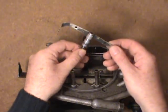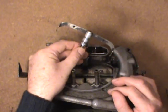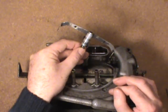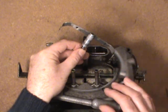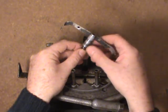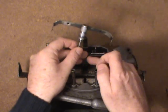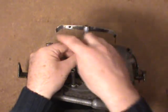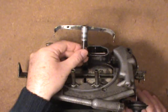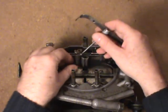If you didn't have that step-up cam like they have in the Thermo Quads, vacuum would hold that down. If you're doing a full throttle acceleration, vacuum would drop, the spring would have more power than the vacuum signal, and it would make the piston come up and out of the cylinder bore higher. That would withdraw your primary metering rods out of the jets to give you a richer mixture. That's just a basic explanation.